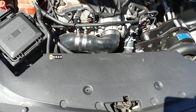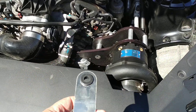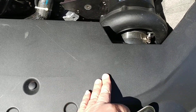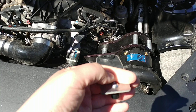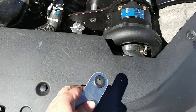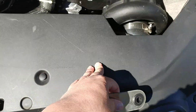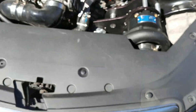Just some small things. For example, this is the upper radiator stay bracket. It sits just below the plastic here and just leans the radiator back. It's protruding just a little bit — I can't feel it right now. But the way that we fastened it was with a hex head bolt at the top. I've switched the design to these low-profile button heads just so that the plastic doesn't protrude. It seemed as though it was just preventing the hood from closing that little bit because the rubber seal sits right here. Just an example of how a tiny little change is nice to discover.